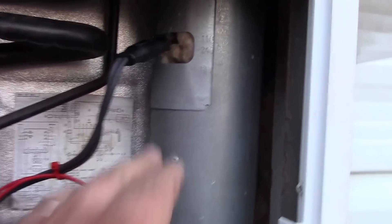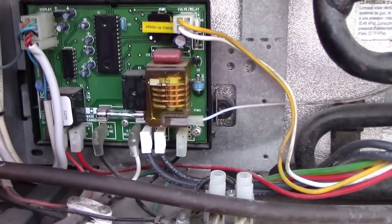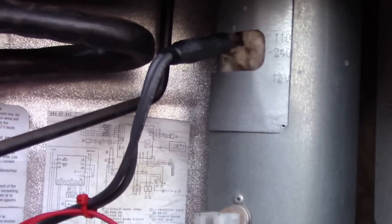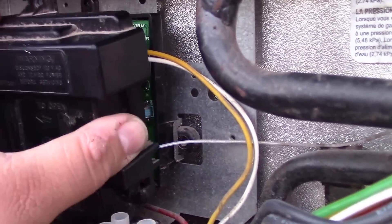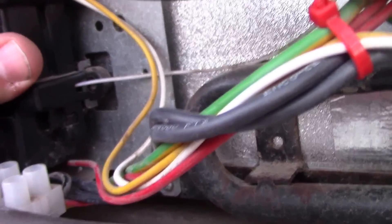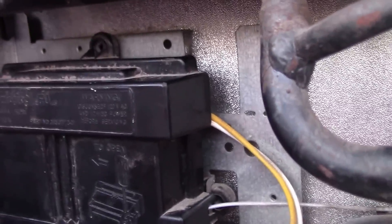If your fridge is like that, you can do this yourself. Just be careful of sharp edges, make sure you don't burn yourself, take this box apart, and make sure the power and battery power are off so you don't short anything out. If you change this and the fridge still isn't working, you may need a new motherboard — this whole board here. To put it back, just line it up, make sure nothing is pinched, snap it back on, and put your screw back in above.